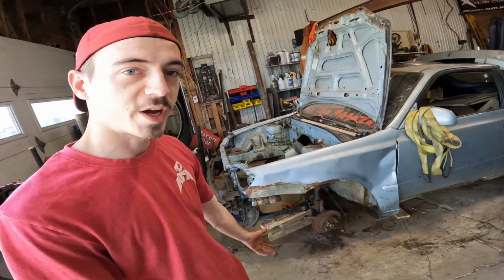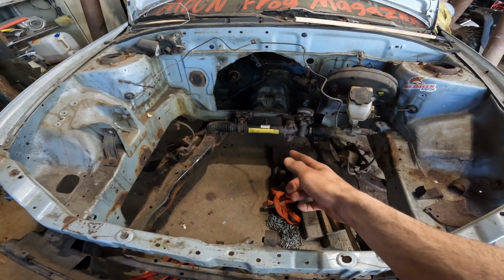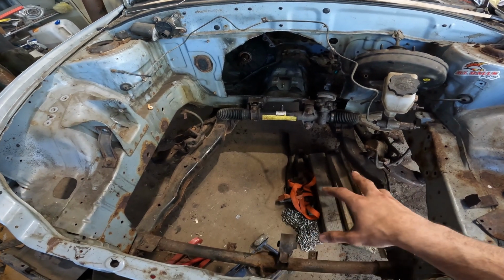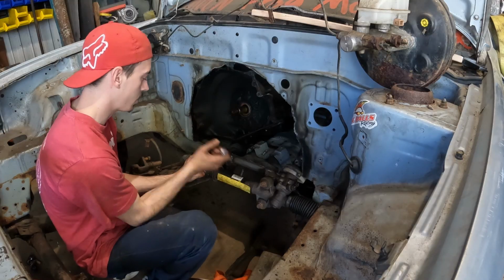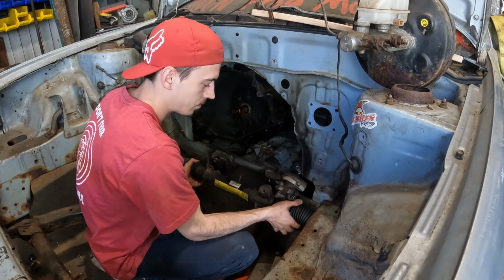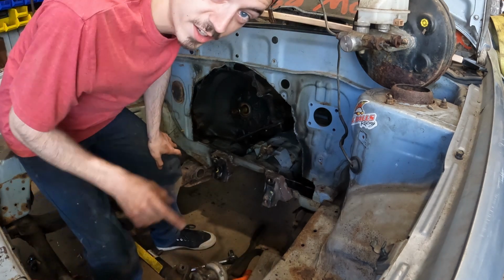We got the knuckles and struts back in. So, next step is going to be to take the steering rack back out, sadly, and we're gonna scoot it forward and attach it back to the knuckles, and then from there we'll figure out how we're gonna mount it back to the frame and to the steering. Now let's tie in the tie rods.